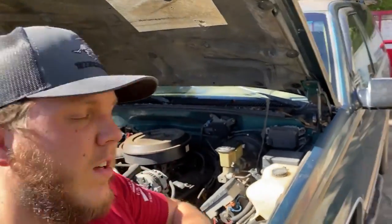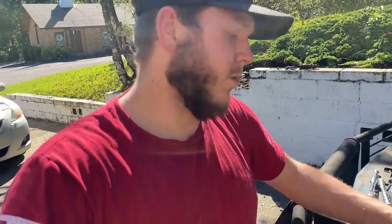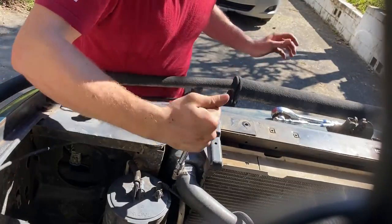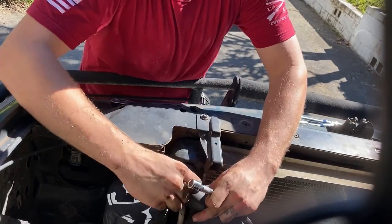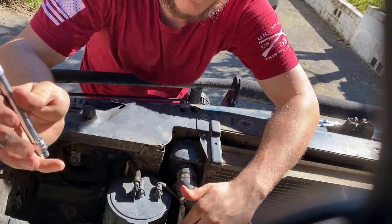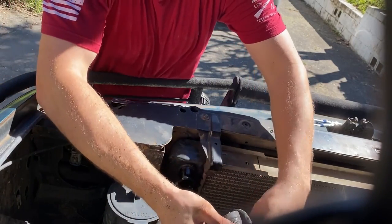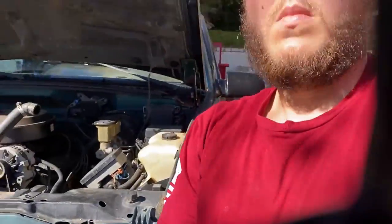Since I wasn't able to show you what the hose clamp looked like when we took it off - here's our hose clamp. It's an 8 millimeter or a flathead. You just unscrew it so you can wiggle the clamp, then you twist, pry, and pull until you get that hose off. Upper radiator hose right here - twist it, see how it's unthreading. There's a little nipple that it goes on. This one came off very easily - sometimes they don't. There's still some coolant in here so we don't want that to dump.